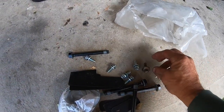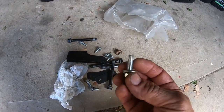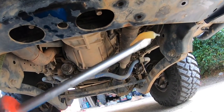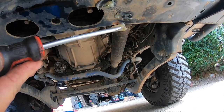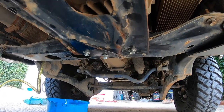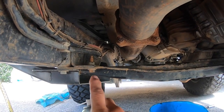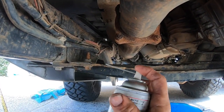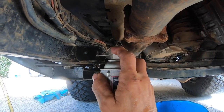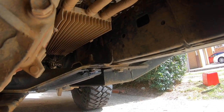We've found a compatible bolt for that bash plate from a spare packet — we'll put them in and hopefully next time I haven't rounded them enough that I can't undo them. I'll throw a bit of grease inside the thread so the new bolts are happy to screw into a bit of rusty thread. Those shiny bolts look a little out of place. If you see nuts or bolts turning a bit feral with rust, a bit of Inox — which I always carry — just spray it so that next time that bolt needs to come undone, hopefully it will.